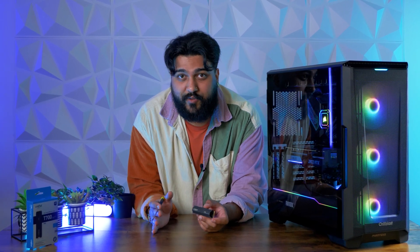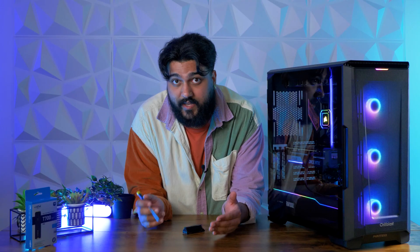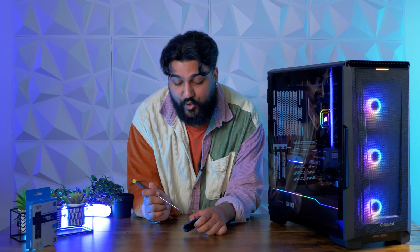It's worth mentioning that the PS5 only uses PCIe Gen 4, meaning you won't be able to make the most out of the Gen 5 SSD if you're on a console. However, the great thing about PCIe is that newer generations are backwards compatible, meaning that even if you have a Gen 4 or Gen 3 motherboard, you can still plug this device in. The drive will run at the speed of the slowest device, whether that is your drive or your motherboard, so even though you can plug this into an older model, it doesn't really make sense as you won't get any of the speed advantages.